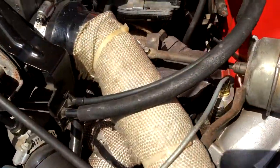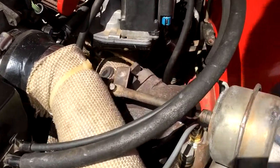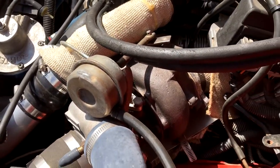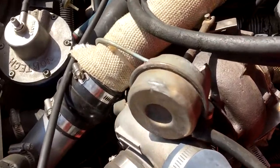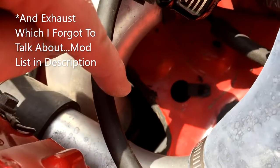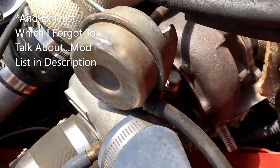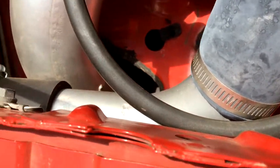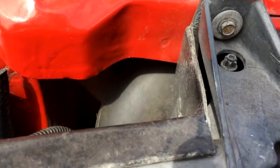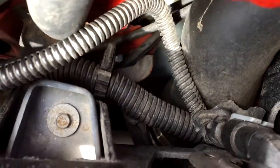So the turbo sits right here. It is a T3 T04B V-trim with a 0.63 A/R exhaust housing, custom built by Blast Performance. I did all of the intake tubing, so there's an AEM dry flow filter down in the factory location. It comes up a couple bends, 3-inch tubing to the compressor, comes out 2-inch bend, 2-inch custom-made tubing, comes down through a custom hose here. It's a 2-inch formed custom hose, goes down through, it makes multiple bends to get down below